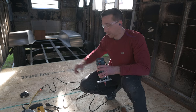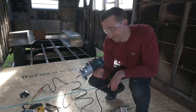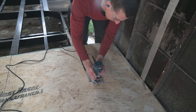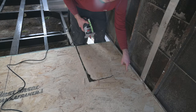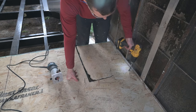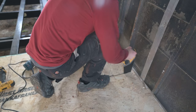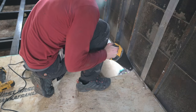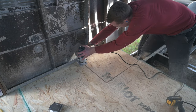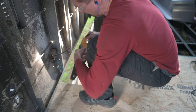I was going to try and measure and cut holes for the wheel wells, but I'm just going to use the router — it's going to be a lot faster and a lot neater. But honestly, it left too big a gap between the subfloor and the wheel wells for my liking. Since this ended up being a template, I was able to correct that in the final subfloor. The router couldn't reach all the way, so I used a handsaw to finish the cuts.